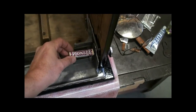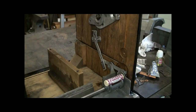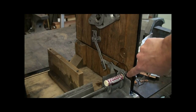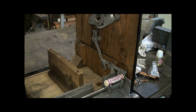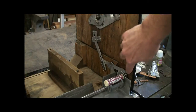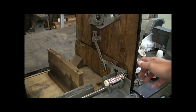Here is where a roll of mints will sit and then be vended to you. Currently, before we play the game, this arm is down and it's catching a wheel here with notches in it, and it does not allow me to turn this handle. But as you play the game, this lever gets pushed downwards and it raises this, which allows another lever behind here to fall forward and keep this up, so that it's no longer catching on that wheel and I can turn it.